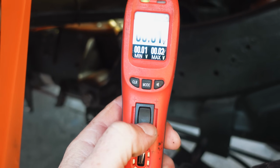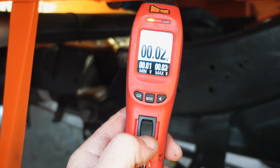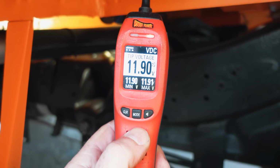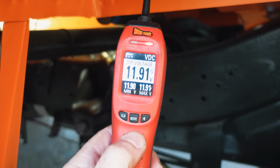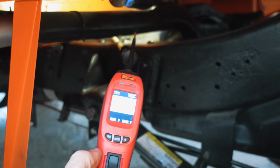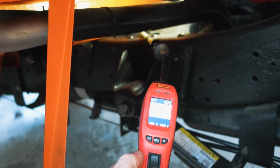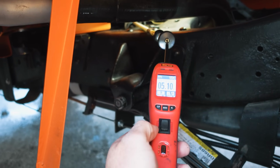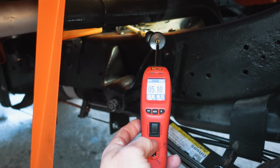So that applies a ground when I flip a switch that way down. When I flip the switch up, it applies power. That's why this is a dangerous tool in the wrong hands. You can add power or ground to things when you should not be. But basically, we want to ground this circuit, and we only want to do it momentarily. You definitely want to have a partner when you're doing this because you can overheat the gauge. I'll describe that for you in a minute.